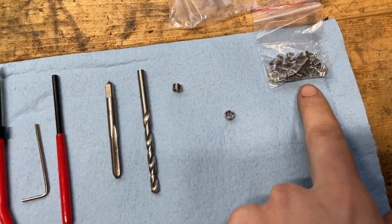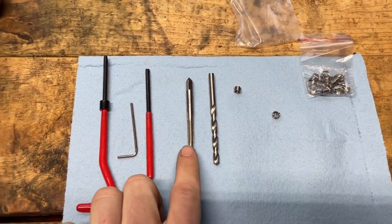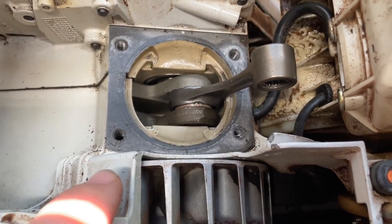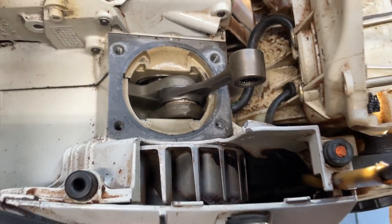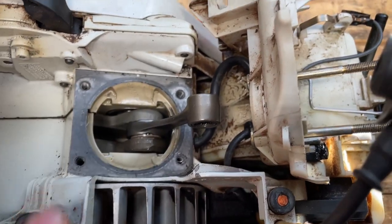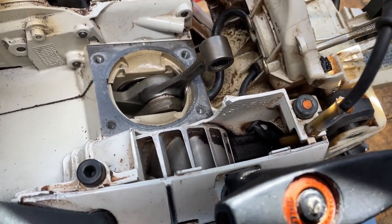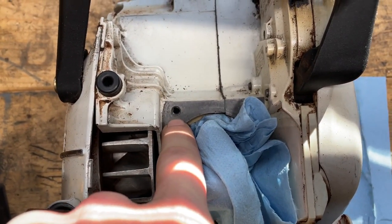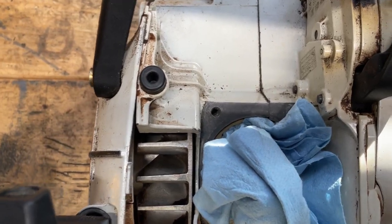There really isn't a lot to it. This kit has 30 thread inserts, and then you have your drill bit and your tap. What we're going to do is take the drill bit, put it on our drill, drill these holes out, take the tap, thread the tap in, and then insert the new threads. We have to be super careful that we don't get filings inside the engine case. So I'm going to stuff a rag in here, and at the end I'm going to vacuum and then use an air compressor to make sure there are no thread filings that went into the bottom end of the engine. Make absolutely sure you're working on the right hole — the last thing you want to do is start drilling out one of the good holes. I block all the other ones from view so I know that's the one I'm working on.